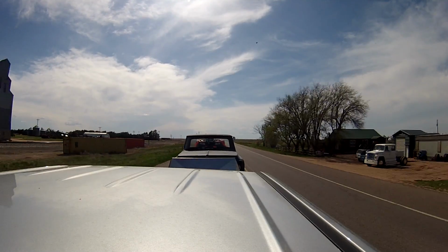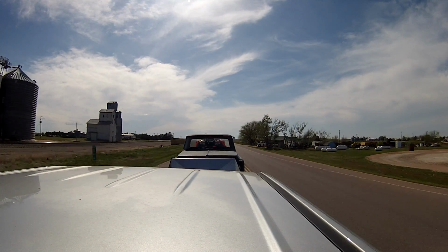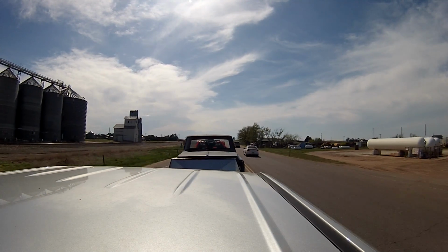Grade shifting is excellent on this. It's like any vehicle, you need to be below 65 miles an hour to actually do much grade shifting. Otherwise, there's not enough room in the RPM band for it to drop a gear. Because it will grade shift by you pushing on the brake. It'll grade shift if your downhill descent is angled enough. It'll do all that automatically.